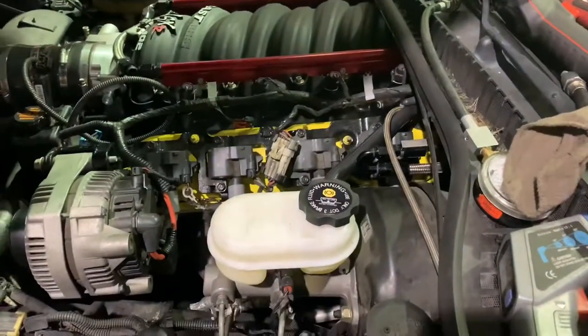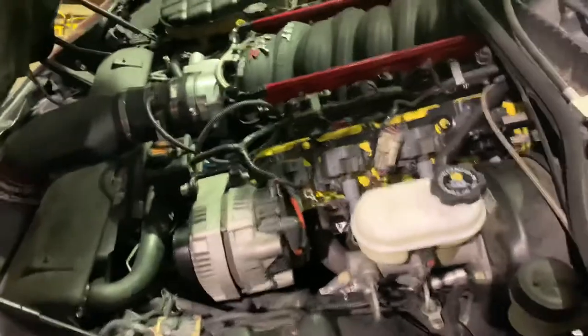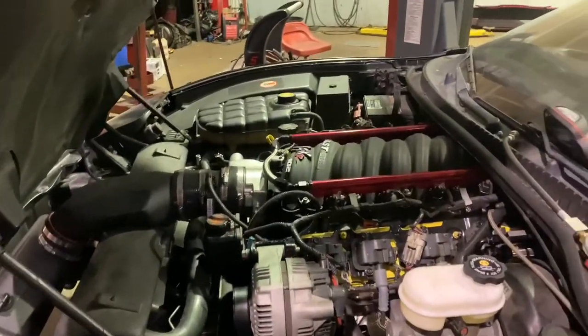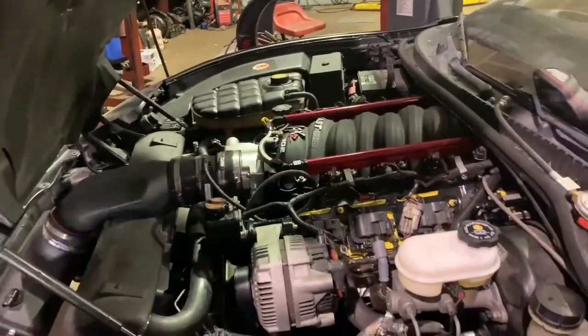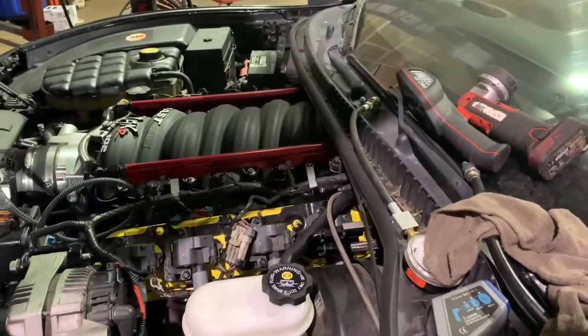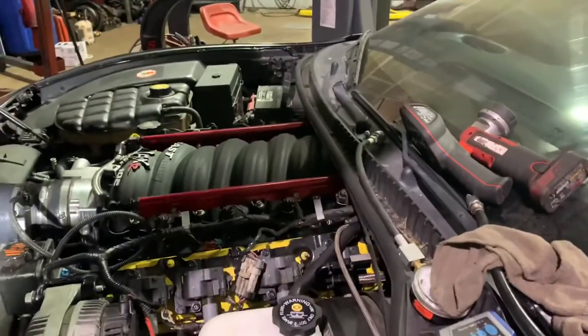So from there we're like, what the hell is this? Tapped it out, bombed it with some brake cleaner and a little bit of compressed air, and it came out. So then it's idling fine — after that, everything seemed cool. We were still down one cylinder because this connector has the pin pulled out of it. We do have to replace that. I'll put the clip in here — it sounded real nasty.